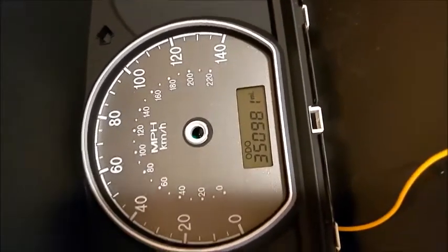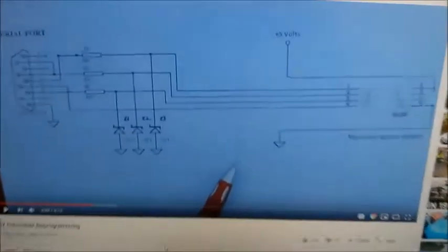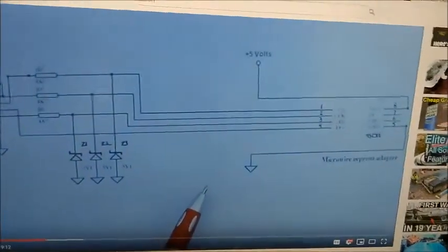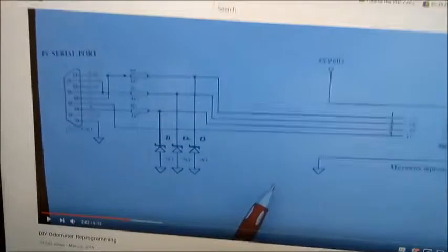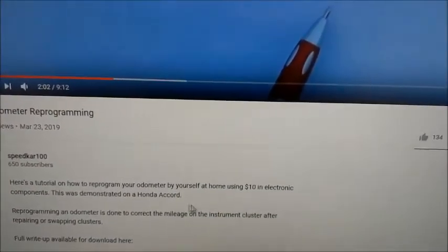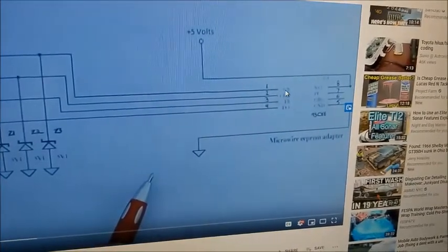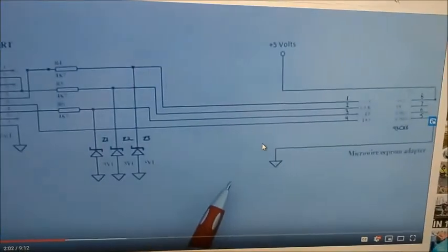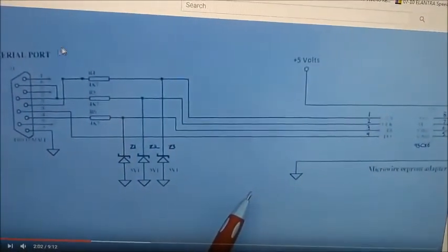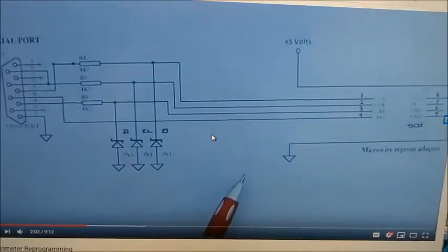If you don't have a programmer like the GQ4X I have here and just want to build your own, here's an easy serial one that another YouTuber uses — it'll work on this too, you just have to put it together. Look up Speed Car 100 — he's got a pretty good video and links for write-ups in his description. That's for a Honda Accord but you just want the programmer information. Solder to each of the pins — pin one through pin eight — and you can program it that way for about five to ten dollars. Then switch back to this guide to finish on the Hyundai Elantra.